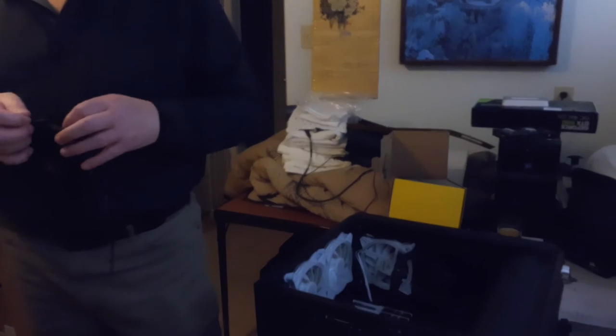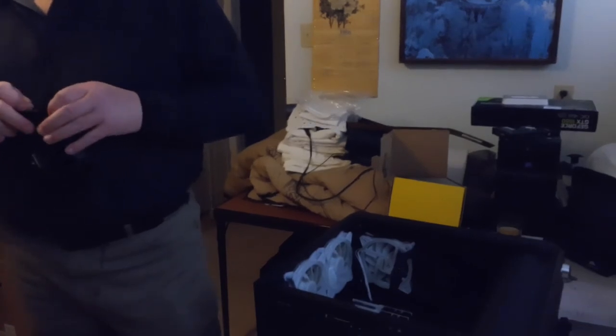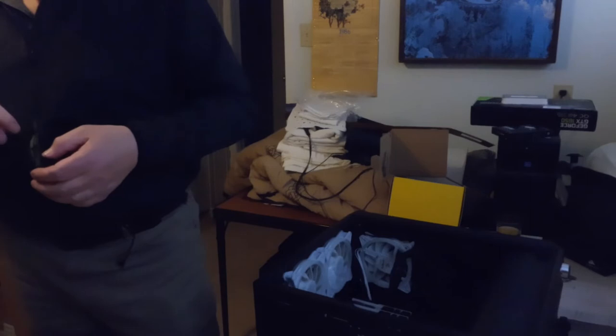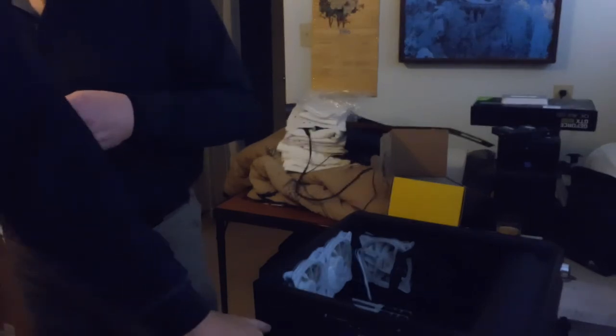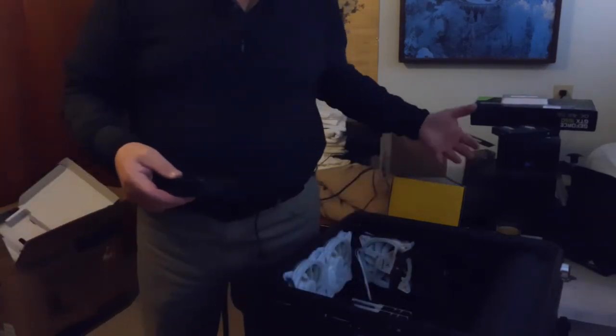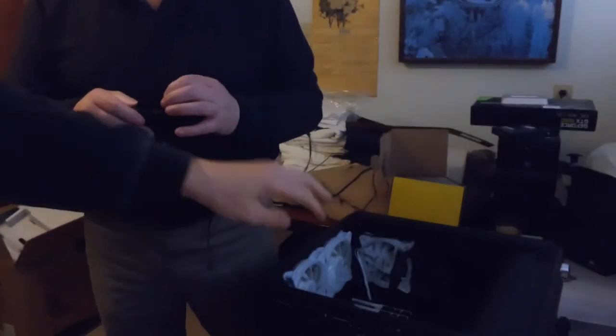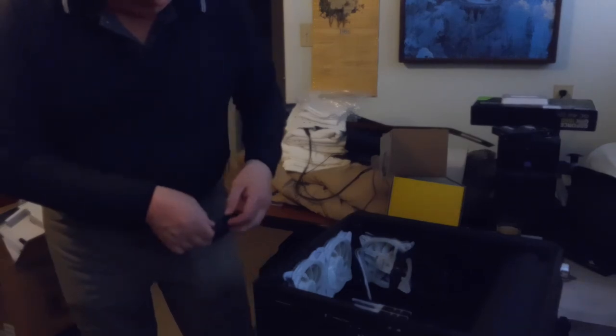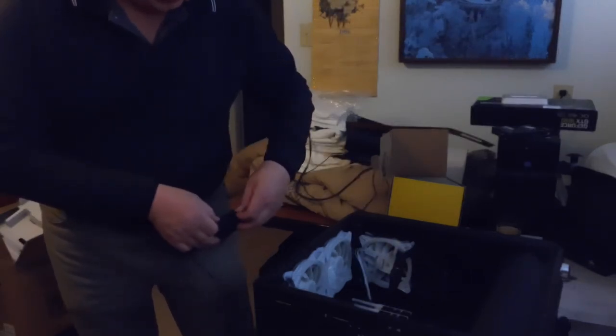We're setting up to put in the big CPU cooling fan. We're going to make sure we get the orientation correct for the airflow through it, relative to the fans that are on the case. These guys are blowing out. This one's blowing out as well, isn't it? This guy here is sucking air in. That air should just go right straight through there. Right, but these guys are drawing air across. Yeah, essentially. Basically, we just have to reverse this mounting bracket. Otherwise, we would have been fighting the airflow.